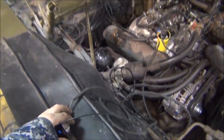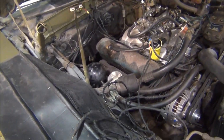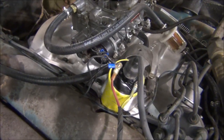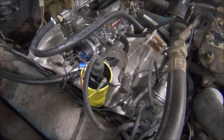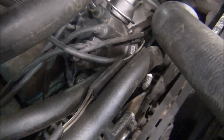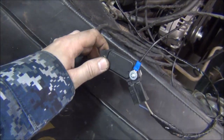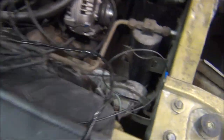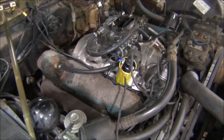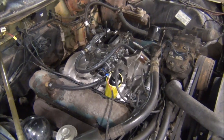Here's a quick overview — I've finished hooking everything up. I got the distributor back in, I've jumpered my connection, and I have my harness hooked up to the positive and negative sides of the coil. I have my connector connected to the distributor, and out here I have the connectors hooked up to the ignition module and it's grounded to the firewall. Just temporarily before I find a place to mount it, I want to see if it will even run. I'm going to set up the tripod and see if she starts.